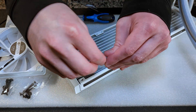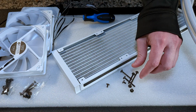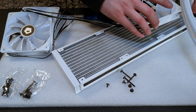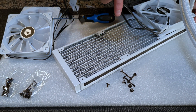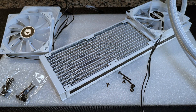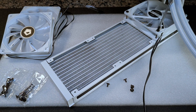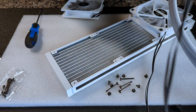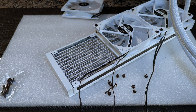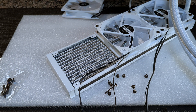We're gonna set up the radiator first. Depending on the size of your radiator you've got a couple packs of longer screws and shorter screws. The longer screws are for mounting your fans to the radiator. The way I'm currently setting it up is for an intake setup, so if you set it up on the front of your case it'll be pulling fresh air through your radiator — should keep your CPU slightly cooler than the opposite option, which is to flip the fans around and have them exhausting. You would do that for the top of your case. Your CPU might run a little bit warmer doing that, but it shouldn't be a big deal unless you're overclocking, like on an i9-12900K maybe.